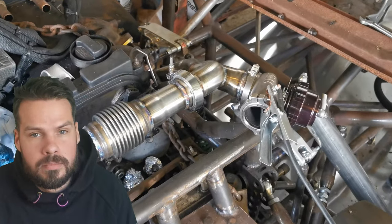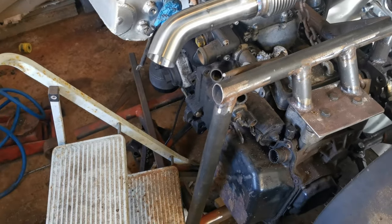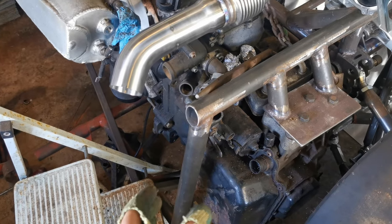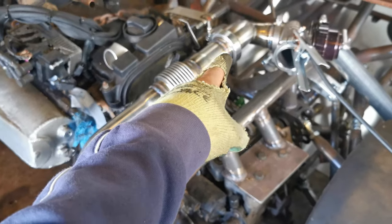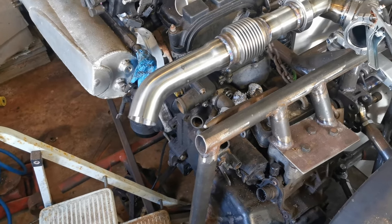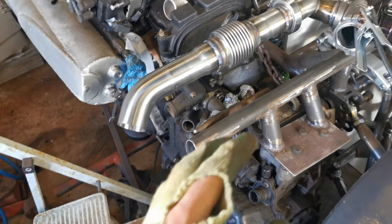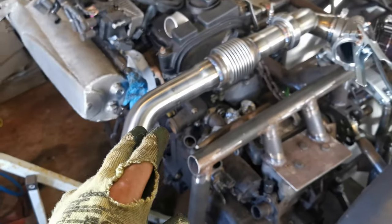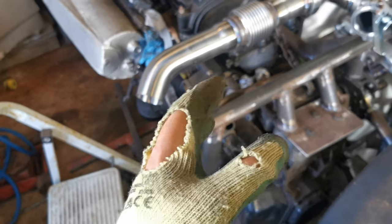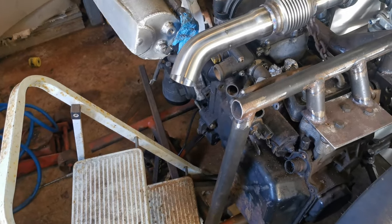Top secret tip — the way I work: if you're a proper fabricator, you'd work out exactly where you wanted the turbo, say here, then mount it in position and build the pipework from the exhaust to the turbo. That's difficult — you've got to be millimetre perfect. So the way I do it is I know roughly where I want the turbo, and I build the pipework roughly to there. When you weld it, it all warps anyway, so get it roughly there and then I'll mount the turbo where it sits.